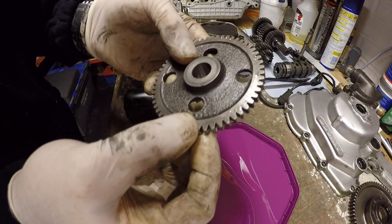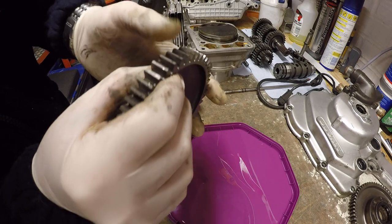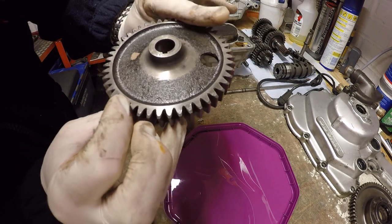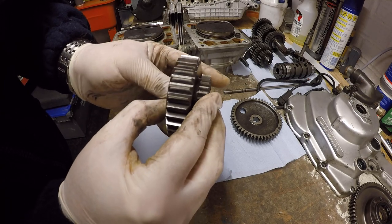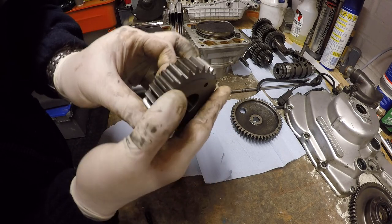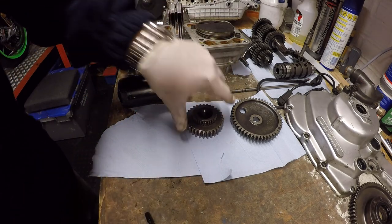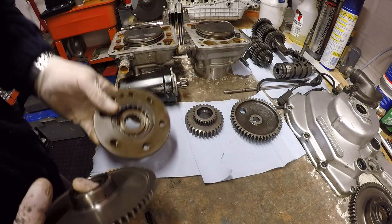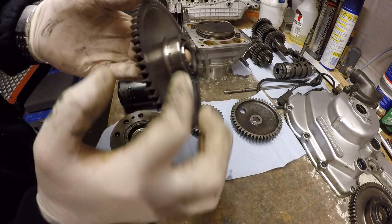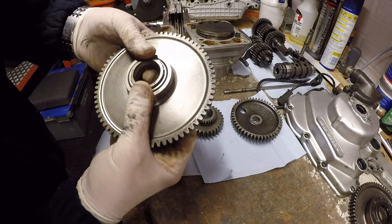The starter drive gear is all in good condition. Main timing wheel — no visible damage. Primary drive is interesting because there appears to be no reciprocal damage from what we found on the primary gear itself, so that's usable. Flywheel mount and starter wheel — the sprag is in good condition, but there's quite a lot of wear around the starter wheel so we might need to identify an alternative. We'll put that as scrap as well.